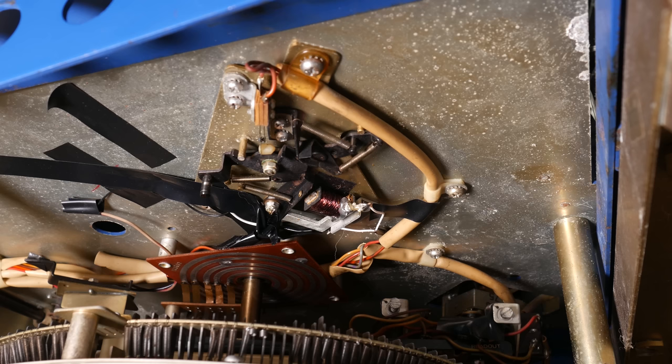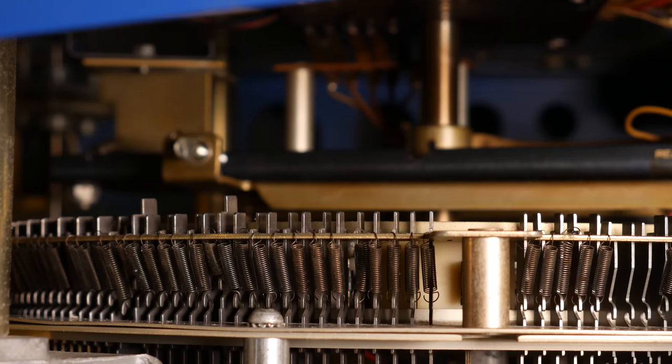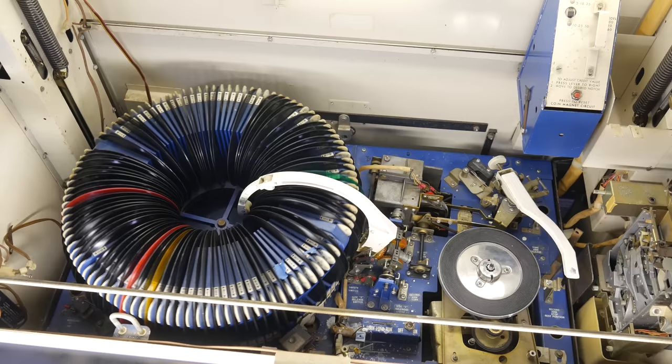At this point, we have a pin sticking up in the selection accumulator, and the carousel motor has power to it to start turning. The readout switches below the carousel will eventually run into the pin. So whatever pin we ran into, the switch gets activated, and that redirects power from the carousel motor, causing it to stop, and sends it to the main cam motor, which grabs onto the record and starts pulling it out